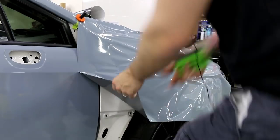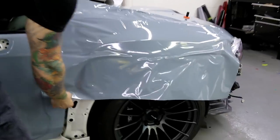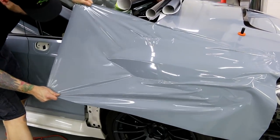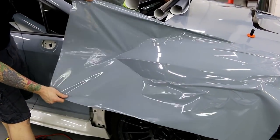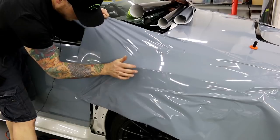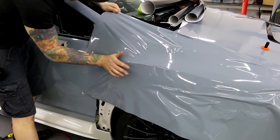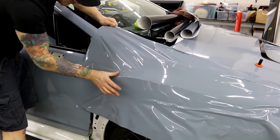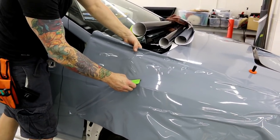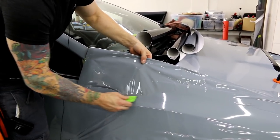The CYS is extremely sticky. Now that I've got it all anchored, I want to remove my magnet and again draw the film out, keeping this body line right here and drawing the film out as smooth as possible. What I need to do now is use my palm instead of the squeegee - this helps get into that little dip there really nicely. Now that I have it like that, I can alleviate the tension - no more stretching, we're just laying it in.